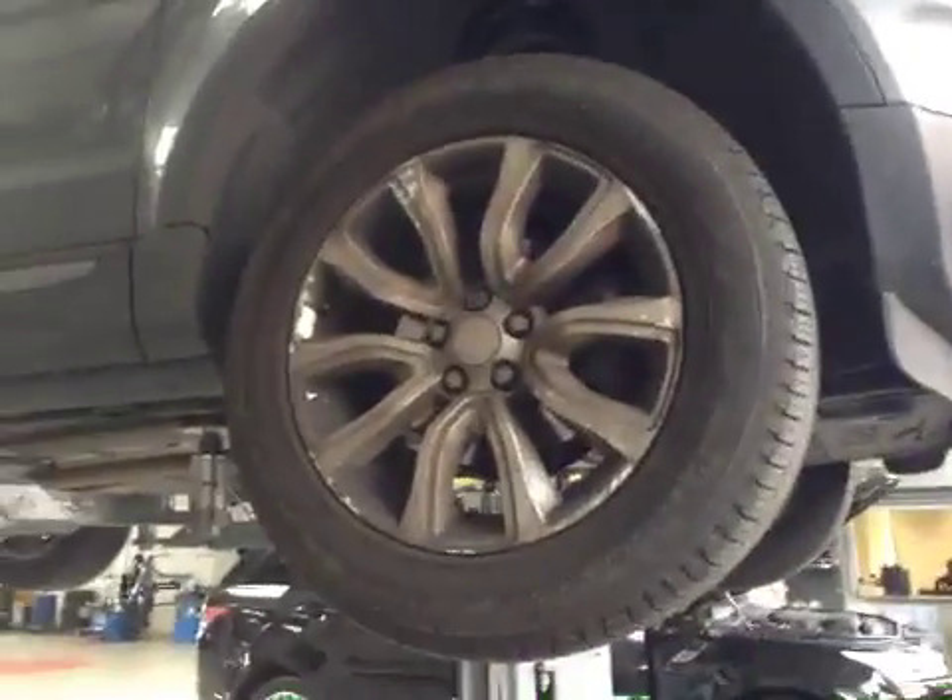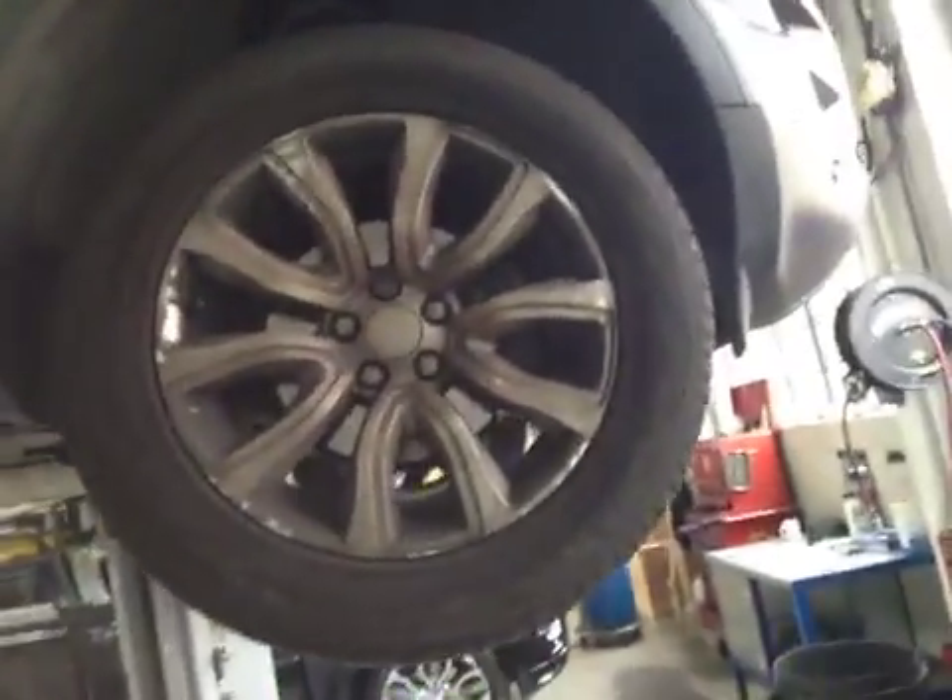Starting off around your driver's side front tyre, there's 6.1mm of tread on this tyre. No cuts to the sidewalls, no exposed cords. Front discs are in good condition, front pads on about 6mm. I'll mark them up in amber on your vehicle health check.